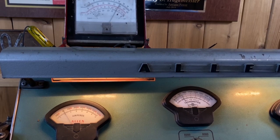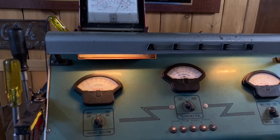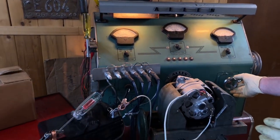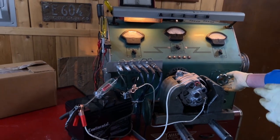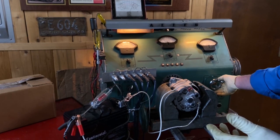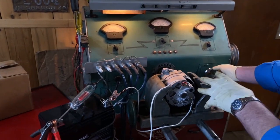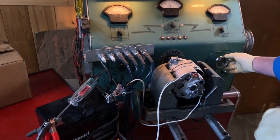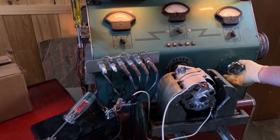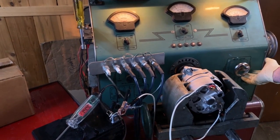It's a B-circuit field and that helps it come on early. The alternators on vehicles typically have a three-to-one pulley ratio — the alternator pulley is usually three times smaller than the crankshaft. So at 700 RPM idle, the alternator is running at 2100 RPM. This one is showing 14.4 volts at just 1000 RPM, so it would be charging right away on a vehicle — no revving up needed.